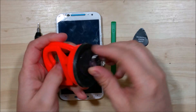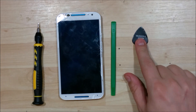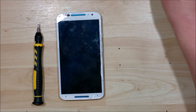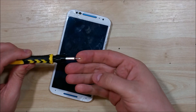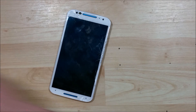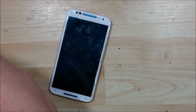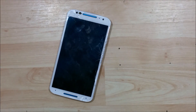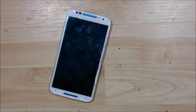The tools we'll need: I like to use suction cups to help remove the back plate. We'll need a couple pry tools — a guitar pick and nylon spudger work well. We'll also need a small Torx screwdriver. If you're following through the glass-only repair portion, we'll be using a heat gun and a couple of playing cards. This is a hot air soldering iron, but a heat gun or hairdryer would work as well if you can get to the right temperature.